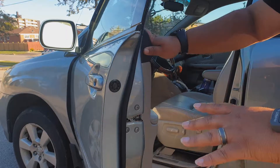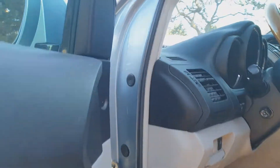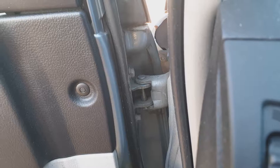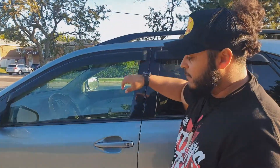To see if a door or any panel has been replaced, you're going to check the bolts. Open the door gently and get a close look at these bolts - two up top and two more at the bottom. You're looking to see if they look like they've been taken off with a wrench or socket. These ones actually look pretty mint - very clean, with no marks indicating they've been removed. So this door is completely safe; nothing happened to it.